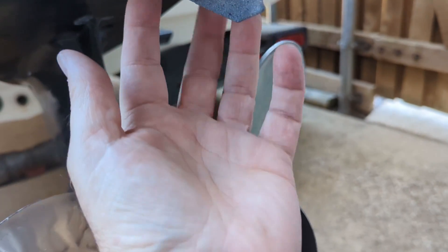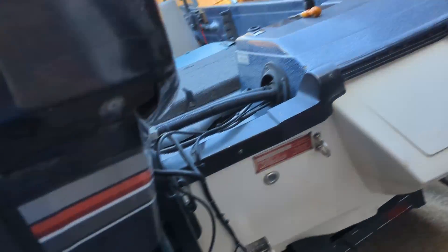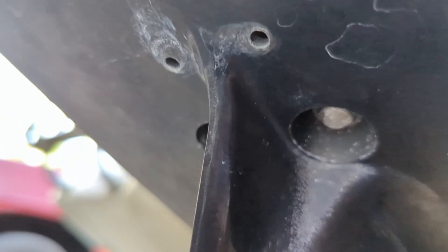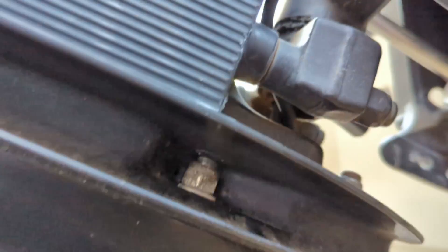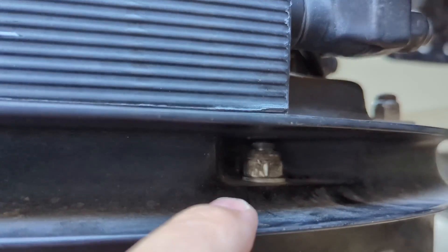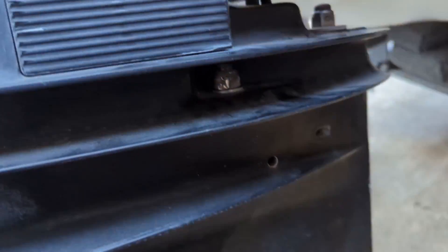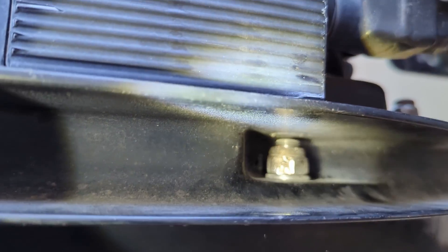The electrical plate will come off and then there'll be another screw right in here holding this on. Then on either side you're going to have screws right there, and you're going to have this bolt and these guys in here — there's not enough clearance to just take that out. So what you have to do is loosen them, it drops down, loosen some more, it drops down, and keep doing that.